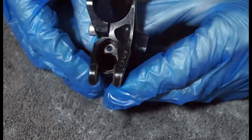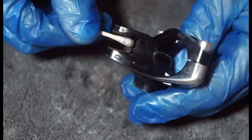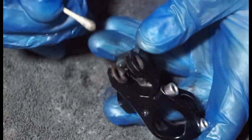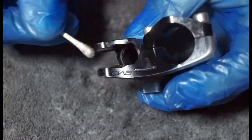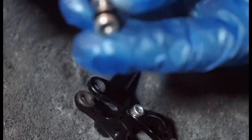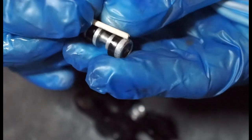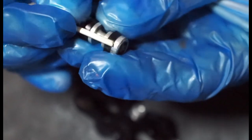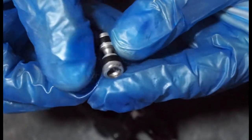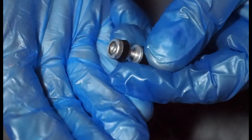With this one, after cleaning it up, it isn't that great to be honest with you. If we look in there, you can actually see the metal, and normally that should be anodised black. If you look at the rest of the bore it's just black, but that section is exposed metal. And what I noticed on this piston — from about here on the piston all the way around to about there, maybe a centimetre or so — it's quite badly scratched. If you've got stuff like that, then it could be game over really. It could be that a bit of grit got down there and just got squashed between the two surfaces. That's something I'll have to try and rectify.